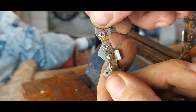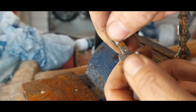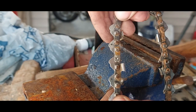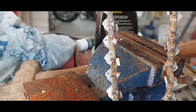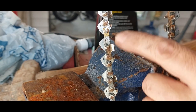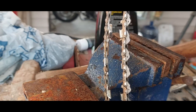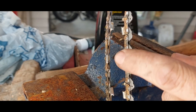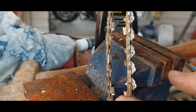As you can see, I've spread that pin out a little bit. As long as it moves fine and your count is the same, you should have no problem at all. Just take out enough links to where the blades are equally spaced from each other. In some cases I've had two blades on one side because of the link I chose to take, which is not a big deal, but it is common practice to have a blade on each side.